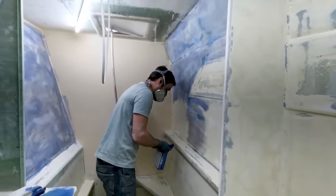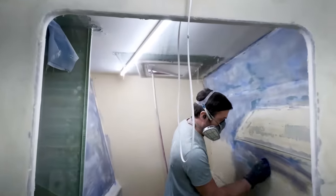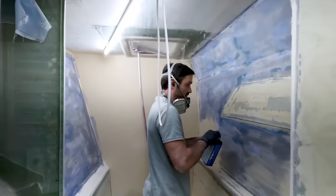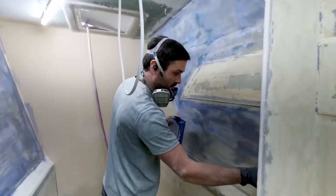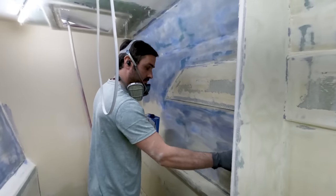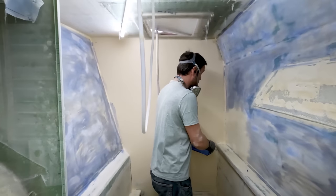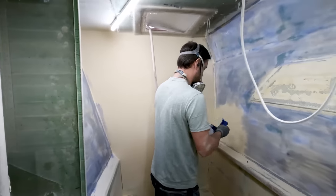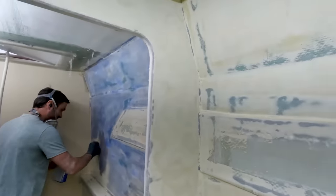As you can tell, Matt has gone pretty hardcore sanding a lot of these areas this morning. So we know we're not ready for primer yet, but instead of just trying to feel our way around to see where high and low spots are, we are using the Dykem blue liquid, which will then sand off, and whatever remaining blue spots we'll be able to see still need to be filled. So hopefully only one more layer of primer after this instead of just guessing, or filler, whatever that stuff is I've been working with for primer now.